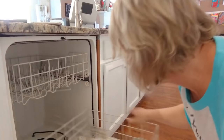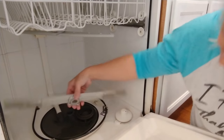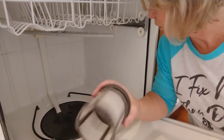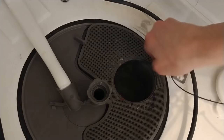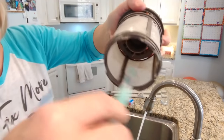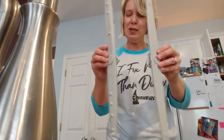So I think something might be clogged in here — maybe one of these little water jets. On my particular model I don't have to use any tools; it twisted right out. There's also the drain here — this is the filter for the drain. It's a good idea every once in a while to rinse this out. You might see little food particles caught down here. I don't think I've ever taken the one off the top, so I'm going to take that one off too. So neither one of these seems to be clogged.